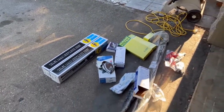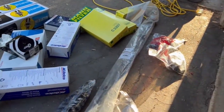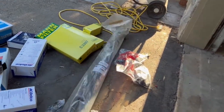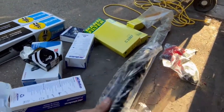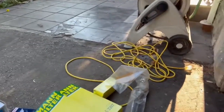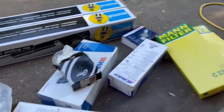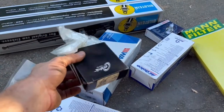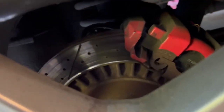Some parts have come in and some are still coming. This is a tie rod end, this is a new steering drag link — I probably didn't need the whole thing but it was only about a hundred bucks — and this is a steering damper. I also got maintenance stuff: new valve cover gaskets, new air filters, an oil filter, and spark plugs. These are brake shoes for the parking brake on the back, plus a hardware kit. New rotors and pads are also coming because the back rotors are worn right out — you can catch your finger on them.